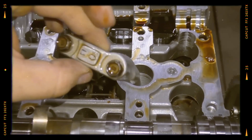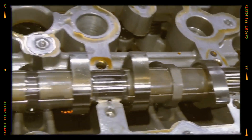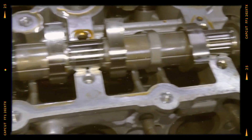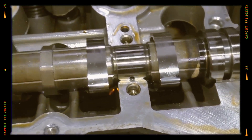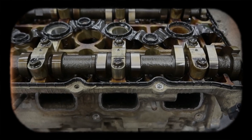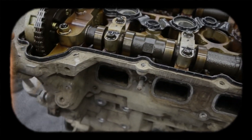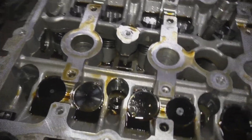The aluminum cylinder head is a 16-valve design featuring dual overhead camshafts and a variable valve timing system, MIVEC, on both camshafts. However, after 2011, MIVEC was only retained on the intake camshaft, so it is not unusual to encounter versions with a single cam phaser.